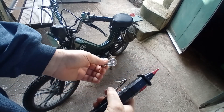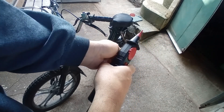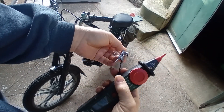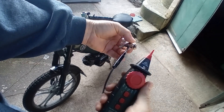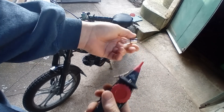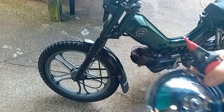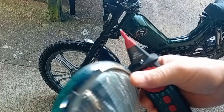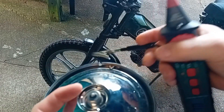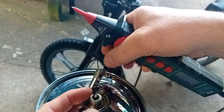The only light I had was the brake light, so I know one of these filaments is good. I've got my new Parkside pen multimeter — I've fitted a crocodile clip on the end of it — set to continuity. It looks like the filament in that bulb is good, so it looks like it's the power feed coming to the bulb that's the issue. Let's test the headlamp bulb. This is the early six-volt style headlight, even though it's a 12-volt bulb — it's only single filament.